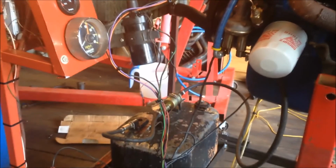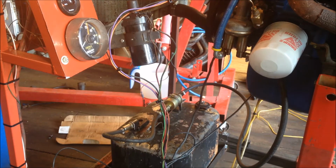On one of my prior videos, when I was talking about the setup with the test stand, another YouTuber, DIY Misfit Mechanic, commented about the fuel pump, that I could use it as a priming pump and then turn it off and the mechanical pump would still draw through that one, if it was a straight through design. So we talked about it and I tested it, and you could draw through it with it off. So I hooked it up that way and it worked out great.